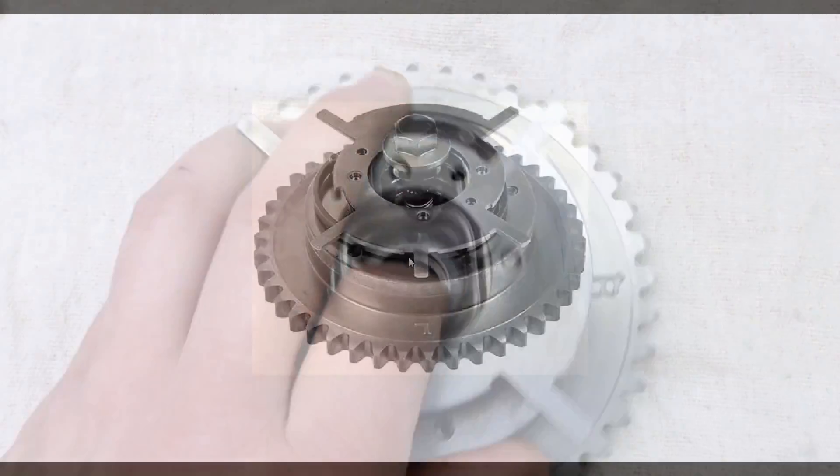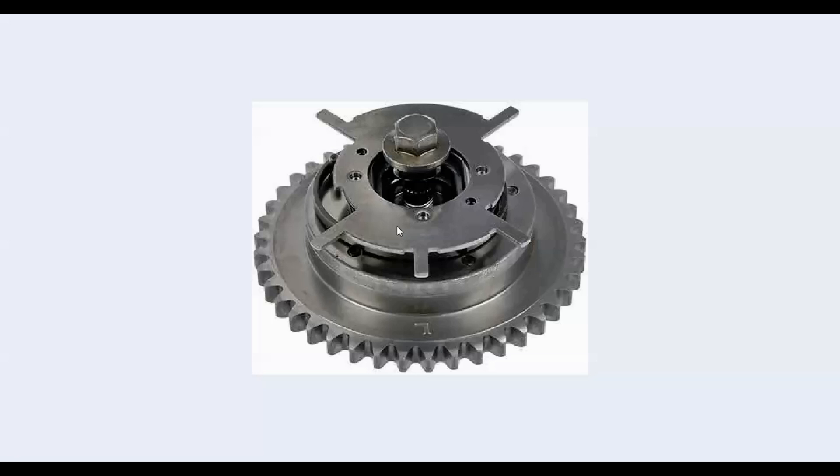There's one more check you can do once you pull that valve cover off. You should be able to see it, or if not, turn your crankshaft so you can see it. If you're trying to figure out any timing issues — maybe a trigger wheel issue or timing codes — look for this middle timing peg right here. At base stock timing, that pin is locked and this middle tooth should just about perfectly line up with the L. If it's not lined up and it's cocked off to the side, you know you have an internal phaser issue and need to replace it.